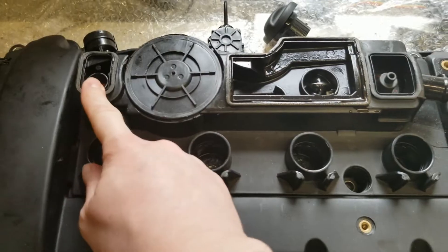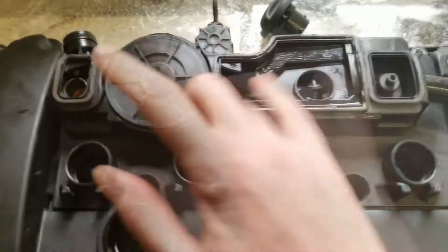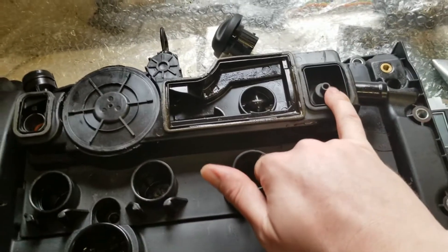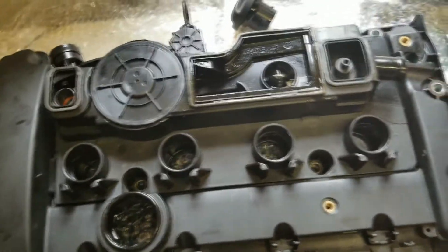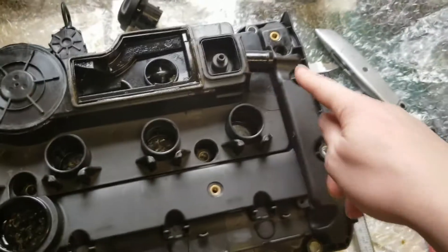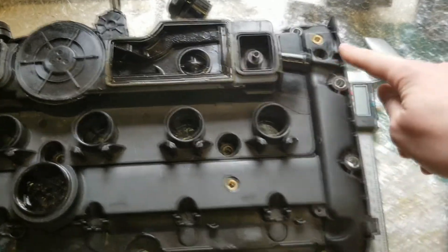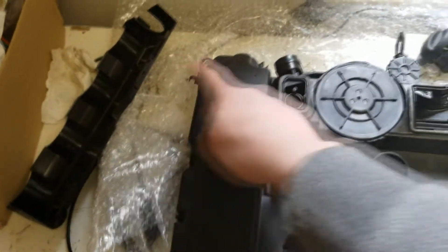That negative pressure happens on this other side. When this side is down, this side starts to draw more air. It's a difference in pressure between the two sides — this side has positive pressure, and this side becomes lower pressure because it's connected to the intake of the turbo. That means this side then lifts up and that side's down. So now air gets drawn through here from under the valve cover, going a longer route on this side — through the turbo, through the intercooler, then through the throttle body and into the intake.